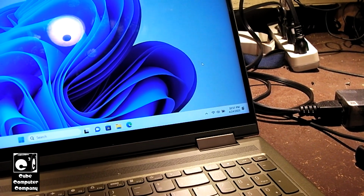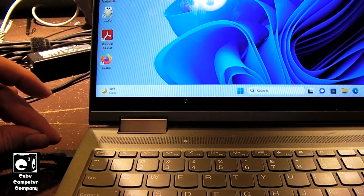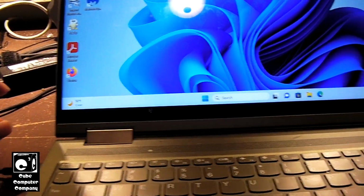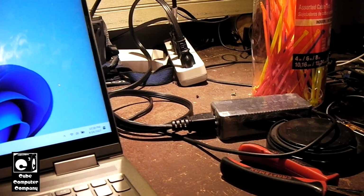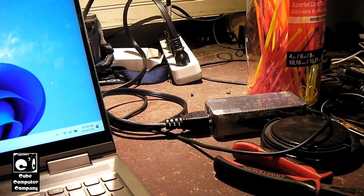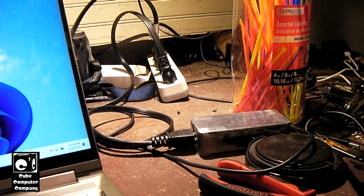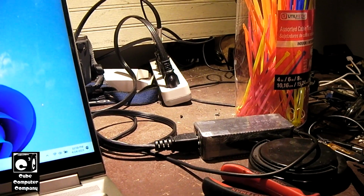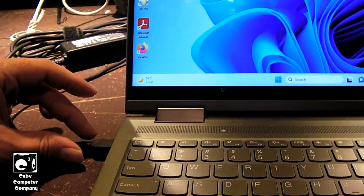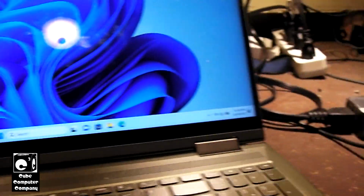They tell me that it was not turning on, and clearly the battery ran down to 0% and it shut off. It wasn't accepting a charge for whatever reason, I don't know. Like I say, the adapter itself could have tripped on a short circuit protection, because there's a chance that it could short, and the crowbar protection would kick in and shut it off. And the way you would reset that is generally by unplugging the AC adapter, waiting like 15-20 seconds and plugging it back in. Maybe that was the case, I don't know. Something could have tripped out the power supply. Don't know for sure, but I have it here, and both ports do seem to be charging.